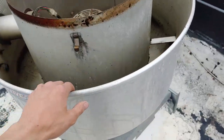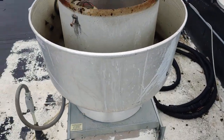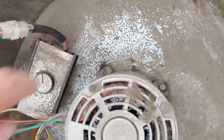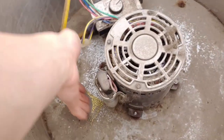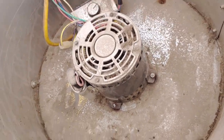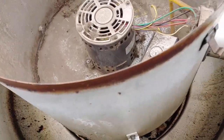This is a captive air range hood over a fryer. The complaint was a clank noise and then it wouldn't turn on — no air, nothing. First thing I'm noticing is these two mounting bolts are completely fine but on this side they're both missing. The second thing is this capacitor is smoking hot, and this motor is also smoking hot. If you can't set your hand on it, it's probably around 200 degrees — quite warm, and that's a bad sign.